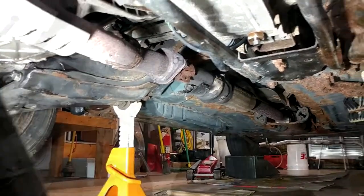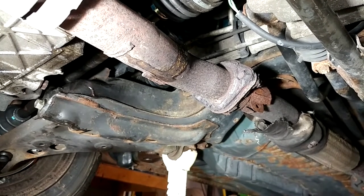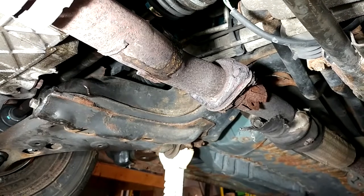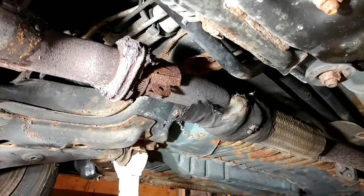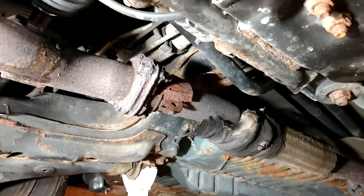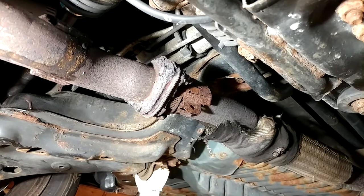Other bad news but this one I saw coming: there's a zero percent chance of me ever getting those bolts out, and I have pretty poor access to get on them with a cutoff wheel. So I'm actually going to take my grinding disc and try to grind the head off of that bolt. The good news is I'm pretty confident those are through bolts and not studs tack welded on, so I think we're going to be in good shape. This is also a good time to show you the hackery done on this exhaust system over the years. When I got this car it had header wrap or whatever just completely all over that pipe barely holding things together — hose clamps, sheet metal, and just stupidity all over this car. The guy worked real hard to try and get every penny out of this $2,500 car when he sold it to me.